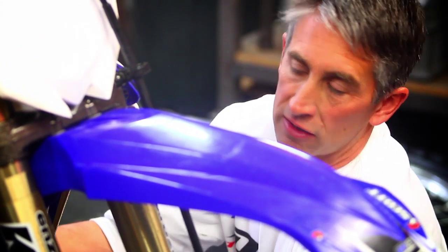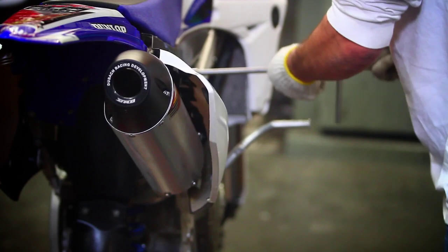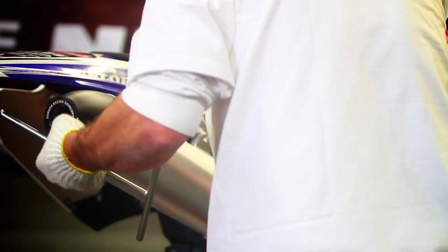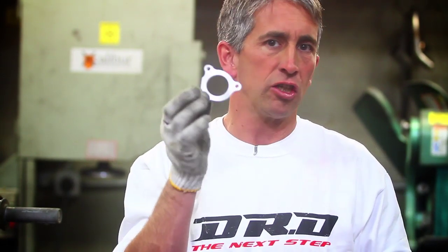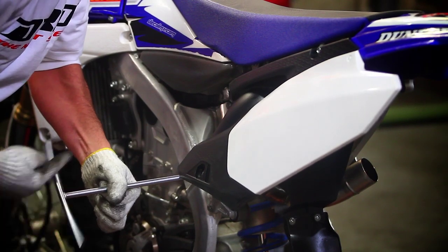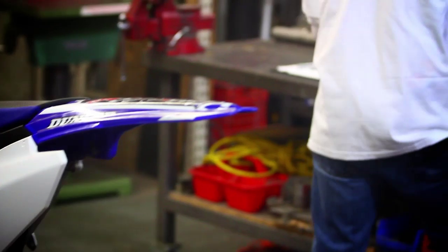The other thing keeping it in is the upper plates. The reason you remove the exhaust pipe is that when your engine moves forward, the alignment of the head pipe and mid pipe will be a little off. We provide a spacer that's the same thickness as the distance you're moving the engine forward, so you put the spacer in to move your head pipe back that same distance. This works with any pipe — stock or aftermarket.